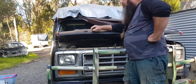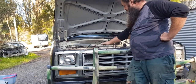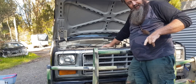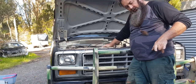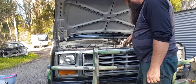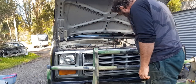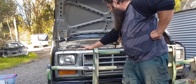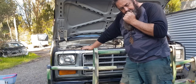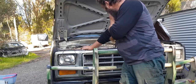It still leaks, rain gets in everywhere. Anyway, what we've got to do is replace the radiator because it's pretty cooked — it leaks everywhere. I have another radiator that's exactly the same, not sure how good it is, but as long as it doesn't leak we're fine. Shouldn't be too hard, just trying to get in there with the bull bar and stuff, a little bit of a pain. I'll spray some stuff on it. The only thing is the auto trans lines might be a bit of a problem because they haven't been out for a while.